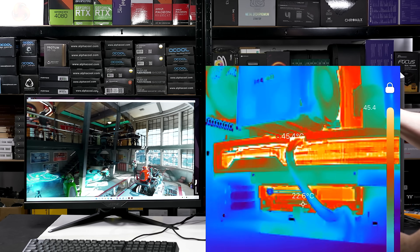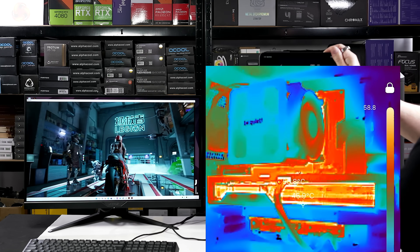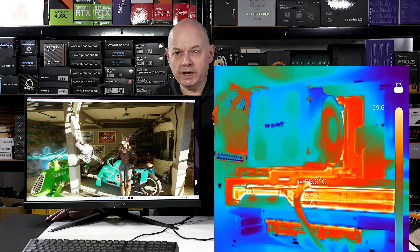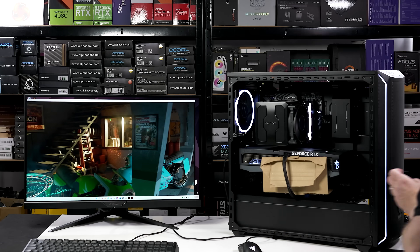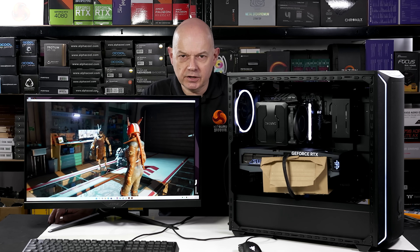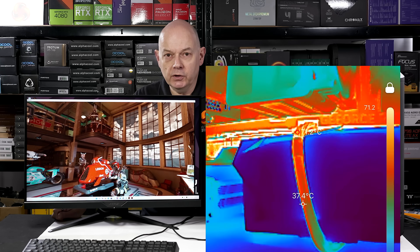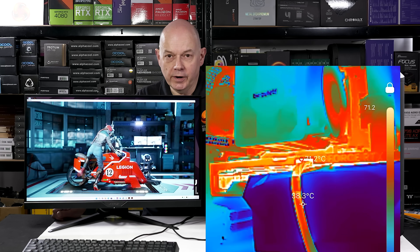When the Speedway stress test starts, the graphics card cooler is at about 45°C and it quickly rises to about 60, then equalises at 70. The thermal images show the graphics card cooler, the power cord, and the connector all in one big chunk. So here's how we isolate the power cable and the connector — using Amazon cardboard rather than a 3D printer. The cooler on the GPU is at around 70 as expected, and the cable is below 40°C.